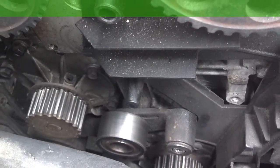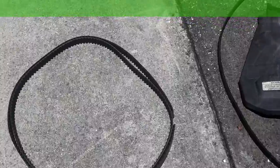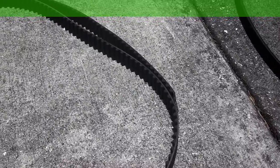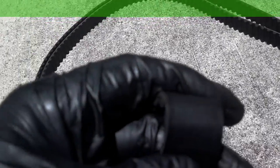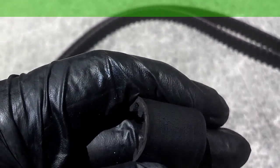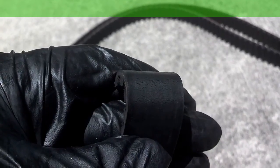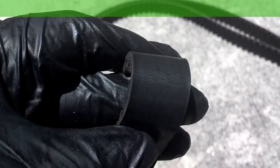The lower engine mount is in good condition, so the owner is checking on an idler roller to see if we can get that. We wrapped the timing belt around the new one — it's four teeth shy, so it's the right size — and this is the condition of the old belt. Starting to get hairline cracks on it. Not the end of the world, but it's a good thing to change them. You don't want them to crack up and break on you.